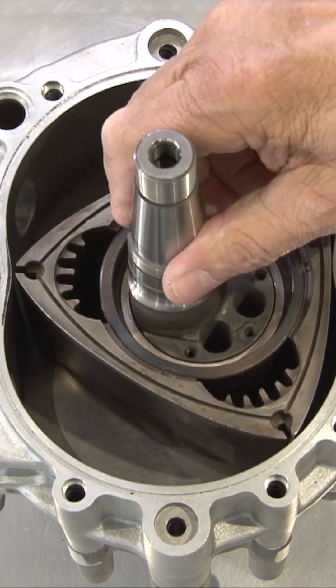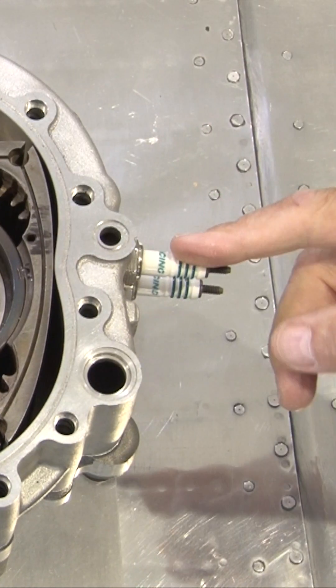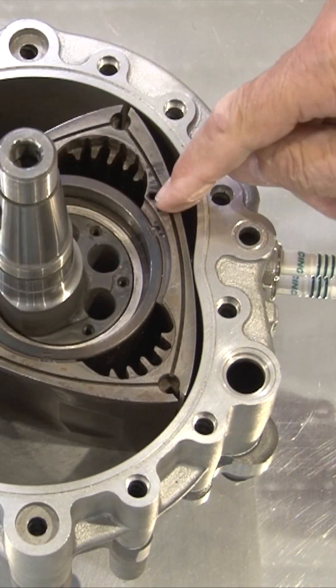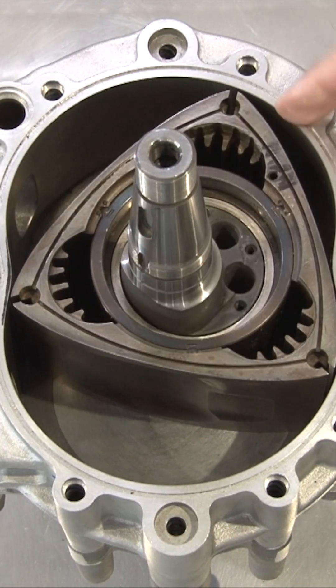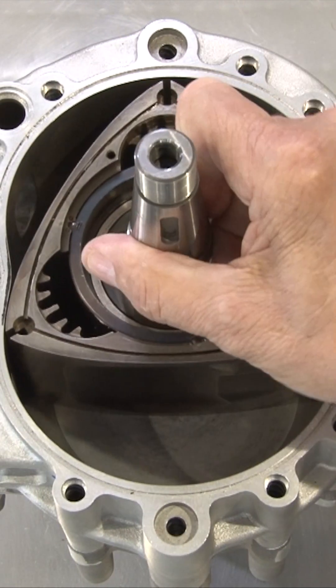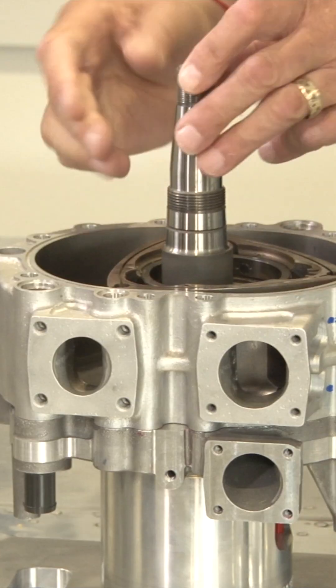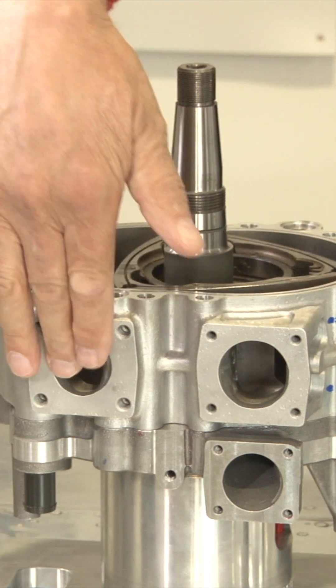So that's like top dead centre, but just before top dead centre, you get the spark plugs here. That obviously ignites it, burns rapidly, which then pushes the rotor around — which is where you get the power from. So that's expanding now. That's like a piston engine at bottom dead centre, but just before that, the exhaust port's opened and it exhausts.